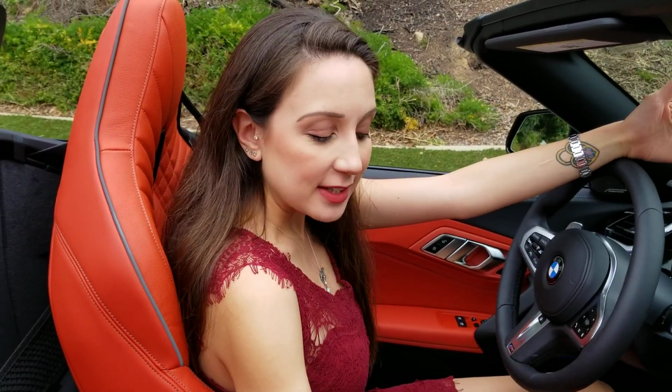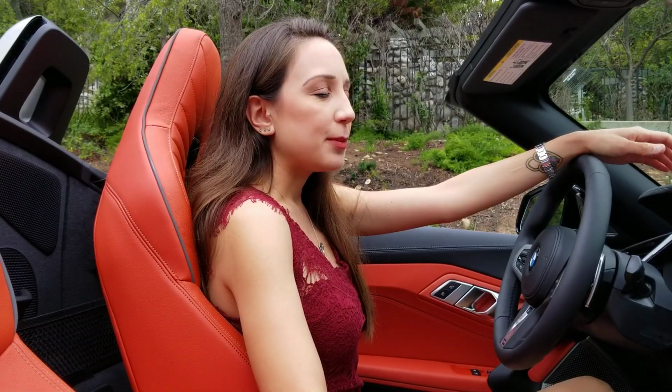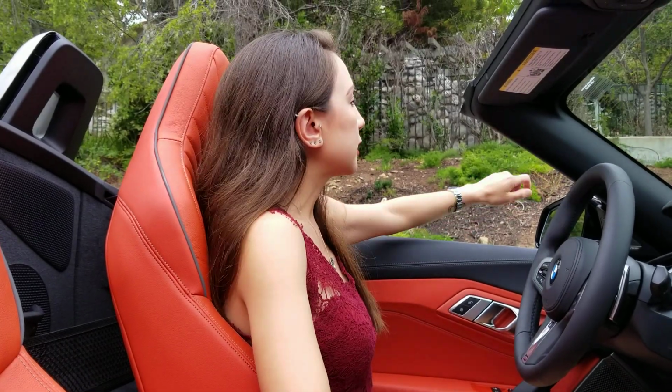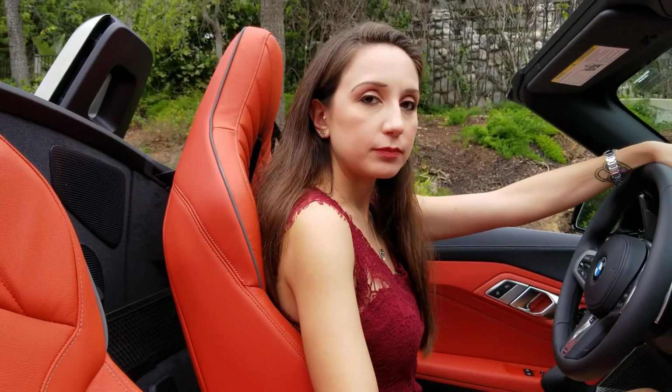Basically, the idea is that the car thinks you're falling asleep. So if you do have your turn signal on, it won't do that. I know a lot of people are guilty of not using their turn signal, so you can turn off the steering intervention solely because it's a little strong. And then the blind spot detection, of course, is the triangle that's illuminated on the side mirrors. That's going to activate at 15 miles an hour or above, if a car is in your blind spot.